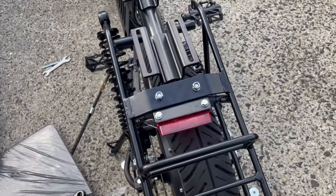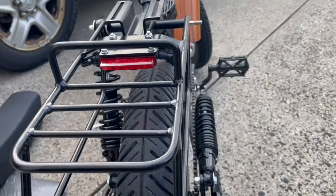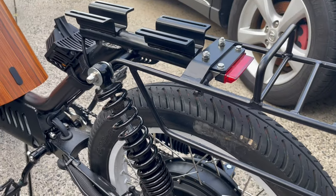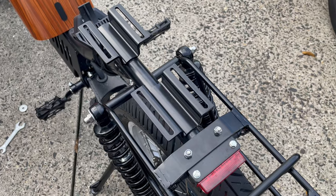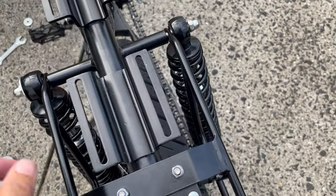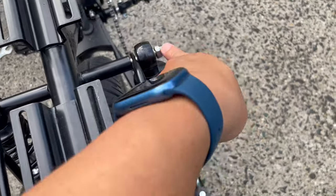With the shocks off, we put on the rack — you can see the two bolts and where they go. Now we just put the shock back on and then the seat, and that's pretty much it. The hard part was holding up the bike and putting the long rod back in because it's heavy. To save you some time: there are two washers sitting here — take them off before you reinstall the rear shocks, because they won't fit with the rear rack holding in place.